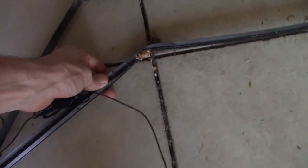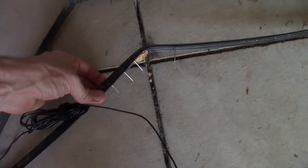There's the old ones. And if you look at this old T-molding, there was a bunch of spots where they had nails pushed through, just trying to keep it on. And this is 3/4-inch textured T-molding, which isn't right for this game. This game had, I think, 13/16 offset T-molding. So like I said, if you get 7/8 and trim it, it's about perfect.